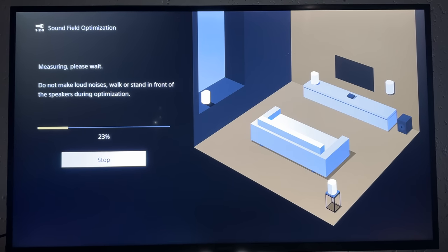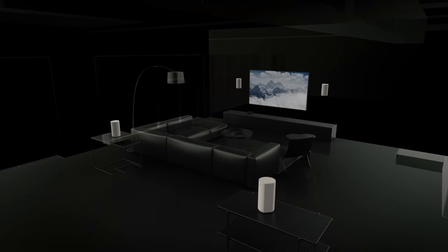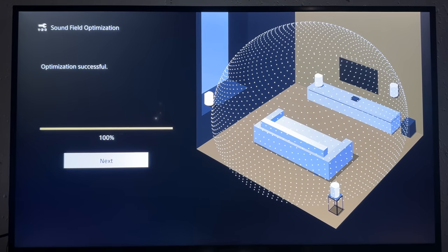Setup: to get sound it's plug and play. But if you want to get the speakers calibrated — which is particularly important in a system like this — and connected to the matrix for AirPlay and Chromecast support, go to the ARC input on your TV and you'll be guided through a calibration process. If you add a sub at a later time, you will need to recalibrate — a small price to pay. In terms of optimal speaker placement, each speaker comes with two microphones to calculate a sense of its location relative to the ceiling and other speakers, so you have some tolerance in how high you can place them. I tend to think getting the center of the speakers around the center point of the floor and ceiling is your best bet. Really try to get as much space as you can between these speakers — it'll make a big difference. This system was perhaps the least despair-inducing during setup and general use of all the soundbars, maybe save Sonos. No drama, which was very refreshing.